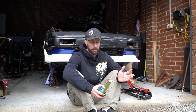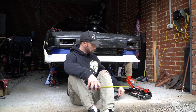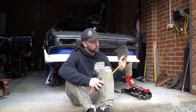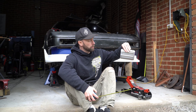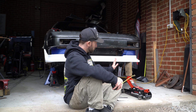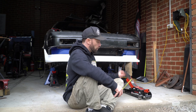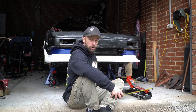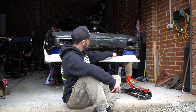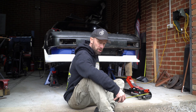We're back - it's Friday afternoon. The reality of building this car is if I get a few hours I just get into it, otherwise we're not going to make that autumn deadline. We've got the plate on the right hand side, the big plate in the middle, and now I've made this plate for the left hand side. I've already tack welded in some nuts for the top. Now I've just got to double measure - I've got a jack with a block of wood just to make sure it's all lined up. I'll give it another measure and bolt that plate in, then drill the other holes and weld captive nuts in.